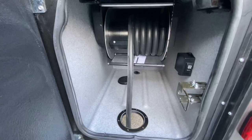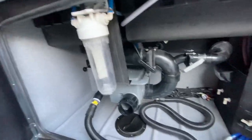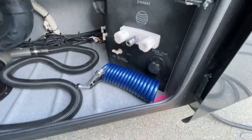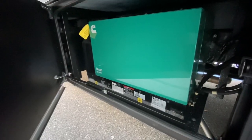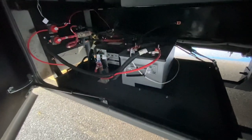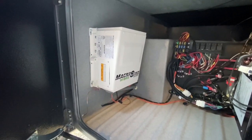The rear compartment is your power cord reel. Next one's a wet bay — you got your RV Sanacon system with full house filtration and low-point drains. Part of the Firefly multiplex is in here, and this is a heated compartment. There's an 8KW quiet diesel generator, more than enough to run everything in this coach. There are your batteries — truck and house — plus your air compressor hookup and isolator switches for the battery. Last compartment is your Magnum, a pure sine wave inverter — and that's a hybrid inverter.